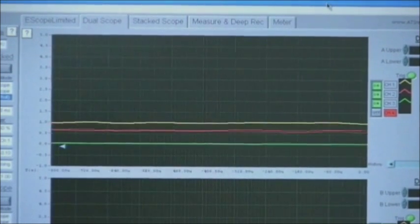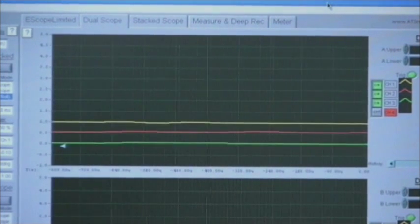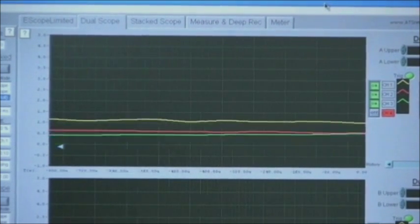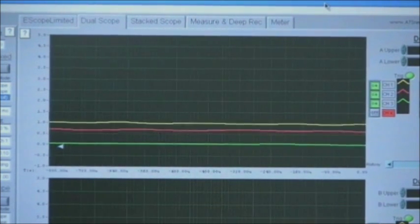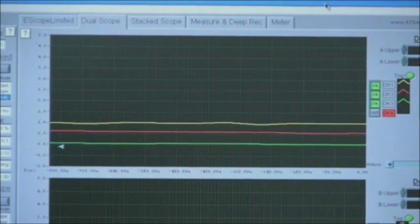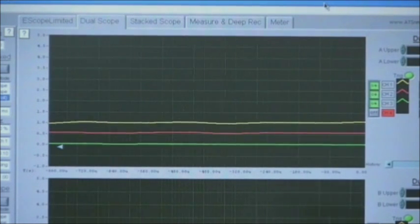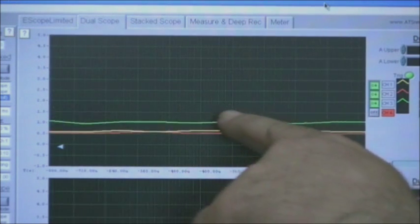Alex, please put it in reverse. Look at that — it went right down to 0 amps, full pressure, and it should have engaged in reverse smoothly and immediately. Let's look at that one more time. Park — you see that green line went up? Reverse — and we went down. Now, if there was a delay with the amperage dropping down, I would look at the transmission range sensor, because if the computer didn't recognize the reverse engagement, it wouldn't change pressure control solenoid C.